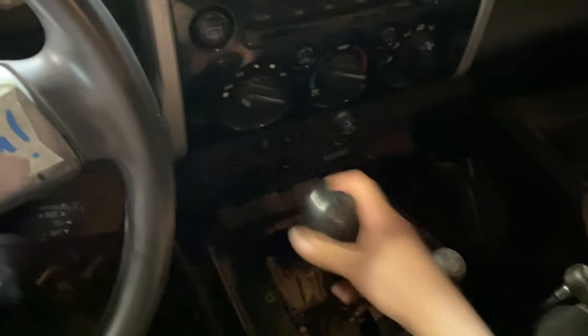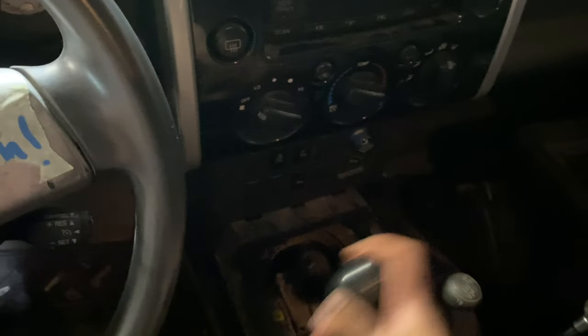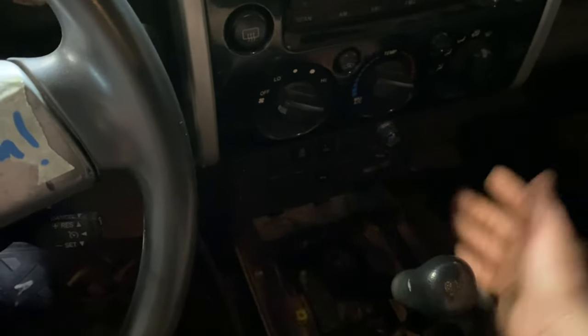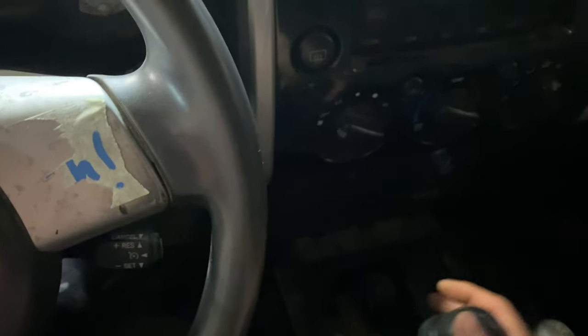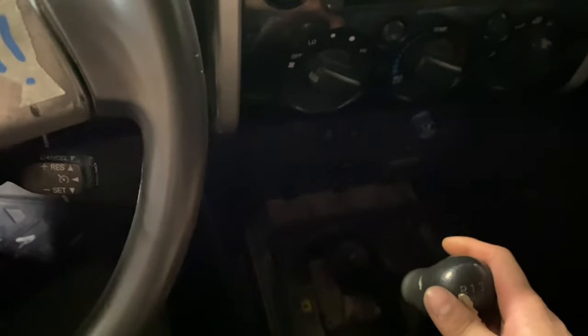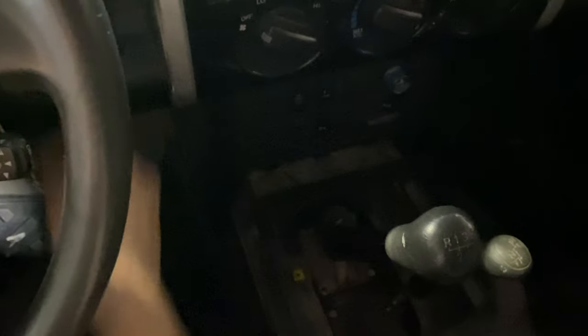Before, all forward gears were okay — let go of the clutch slowly and the vehicle creeps forward, totally normal. But when I put it in reverse and slowly let go of the clutch, it just grinds. It was pretty severe, as you guys saw in the earlier footage. With this new transmission, I've already tested it — I have no exhaust yet but let's try it.